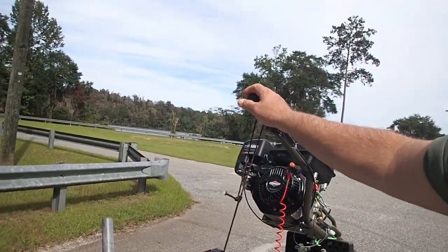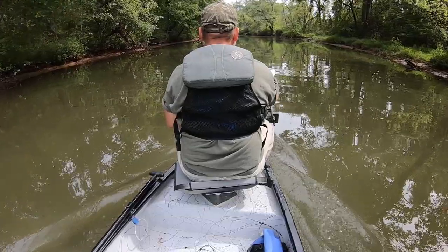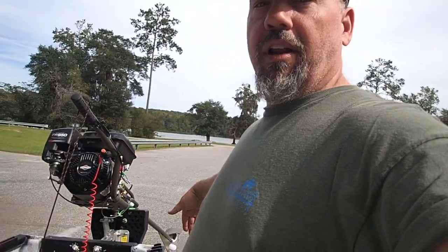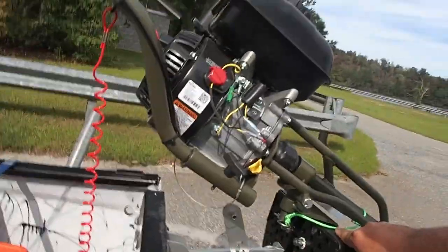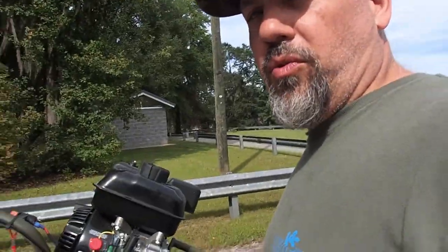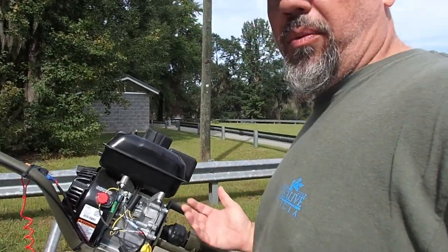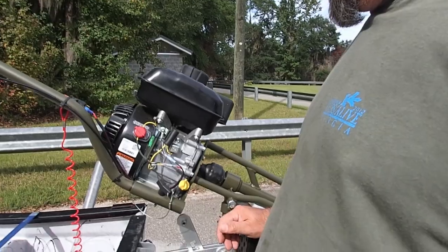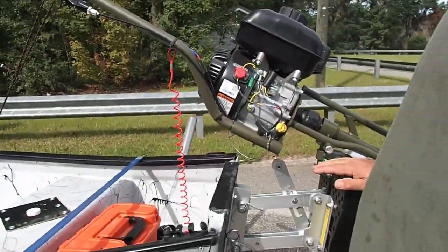This is my own invention — just a taut line hitch. Whenever you're up front, it tends to get a little squirrely back here, so I wanted to be able to adjust the angle on the motor. This holds my rudder in the back while I'm running the trolling motor up front, or when I'm launching so the motor doesn't hang down too far. I had this jack plate that I bought for another project that never came to fruition. It's rated for 20 horsepower and 115 pounds — this motor is only six and a half horsepower and weighs 60 pounds, so I'm well within the parameters. It moves the motor up or down, away from or toward me, wherever I need. It's a pretty neat little setup so far.